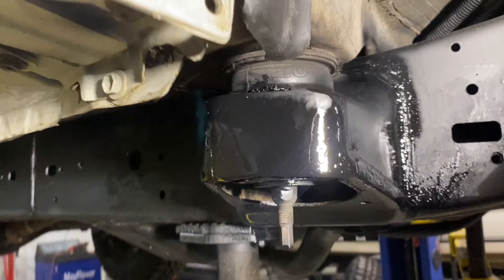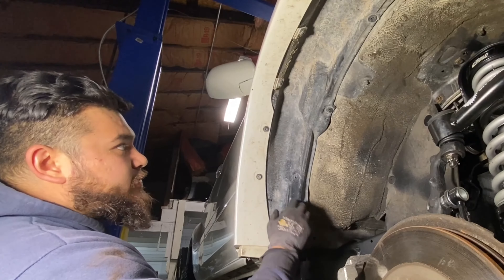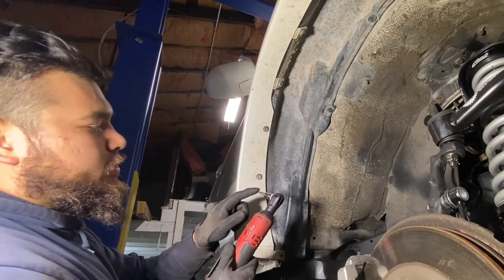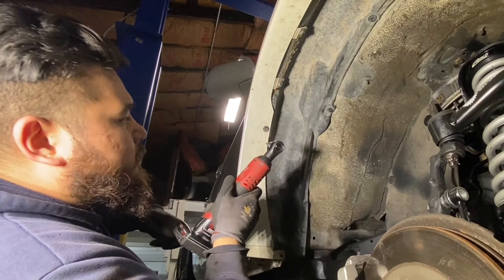Here's the final result for the body mount chop — we'll let that paint dry up. Next we're going to do the body seam mod, and what we need to do is remove the fender liner slightly. To do that, grab a Torx T30 bit to remove these screws. We only need to remove a few, not all of them.